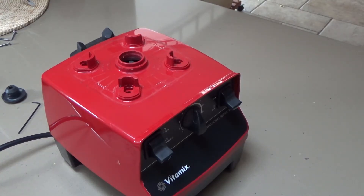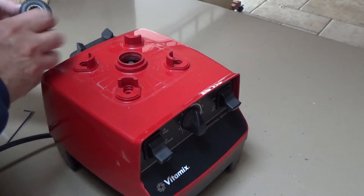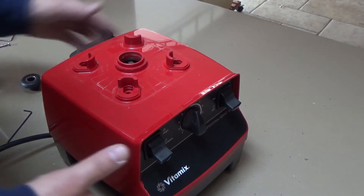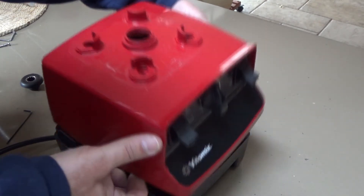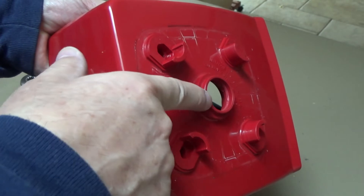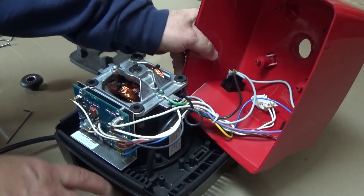After taking this thing apart I came to realize it's the set screw — this holds the attachment between the motor and the container. The next thing I noticed was they have the access hole sealed off, so I'm going to have to remove that seal to get in there and tighten it down. Everything else in here is pretty much non-serviceable.